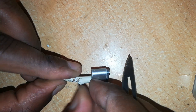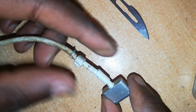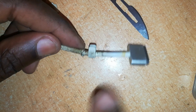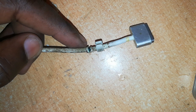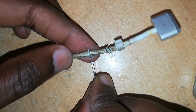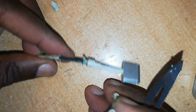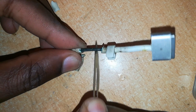Once you make that notch, you can now pull the old insulation out. Go ahead and cut it all the way through. Pull it off — you don't need it anymore. Be careful not to destroy the connector. This wire is broken somewhere here, and we can't have a junction there as it will look untidy. So we'll cut off this rubber at a point where it looks neat. Remove it — you can see there is some decay or a green color on the wires.